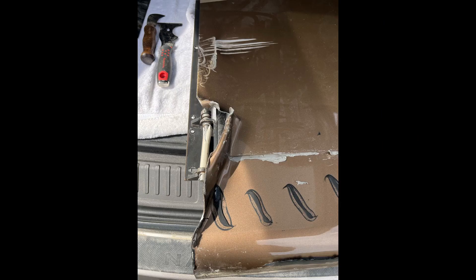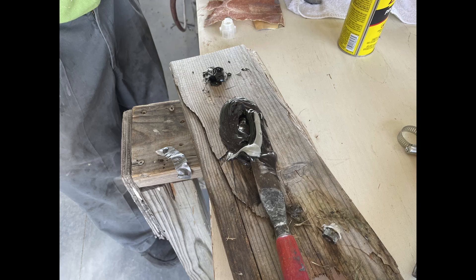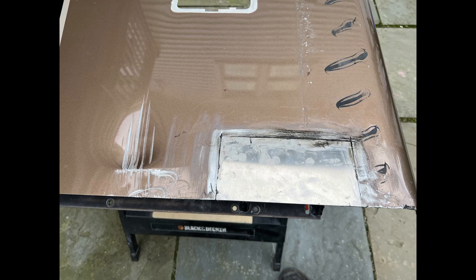So we decided to glue it in using a 3M panel bond adhesive, which smells and works just like JB Weld. And I know it's going to be strong, so we cut out this damaged area. There we are fitting in a piece of aluminum patch panel with a protective coating — that blue plastic — and glue that right in there with a lot of the JB Weld type glue that you see here. And there it is after it's glued in.